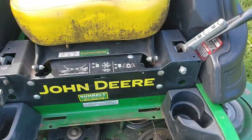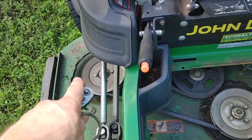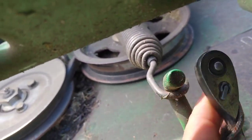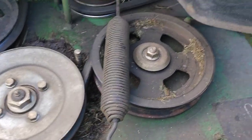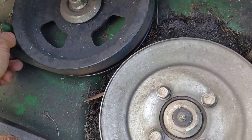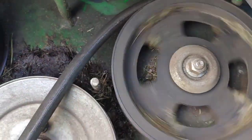I'm going to show you how bad that deck was and the easy way to loosen this belt. You can roll it around a pulley like I've shown on other mowers, but that's not going to take the tension off that spring. So if you need to check all your bearings, I look through here, see the hook right there, and I take a piece of rope — just using a ratchet — put the rope around right there. Now I have something nice and easy to grip, pull like that, loosen it up, and I've got the belt tension off everything. I'll set this spring right there.